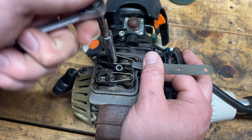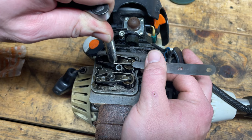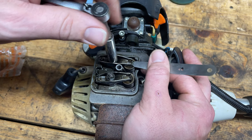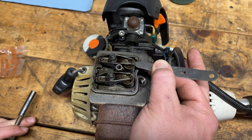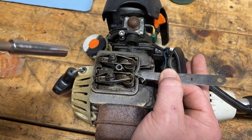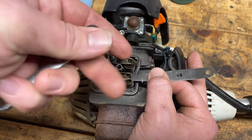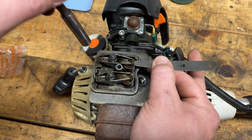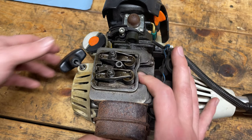And what I do is tighten slowly with my left hand and then move the feeler gauge in and out with the right till we get that bite that we're looking for. There, it's starting to go. I like it a little bit more than that. So it's sticky, but it's not too loose, and I like them to match. So I think the exhaust is tighter, but I'm gonna back it out just a little. So that's too loose. Okay, almost identical.